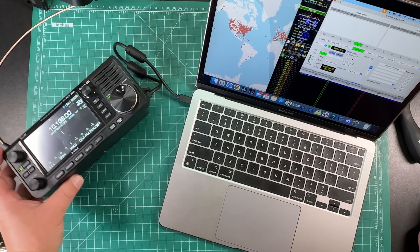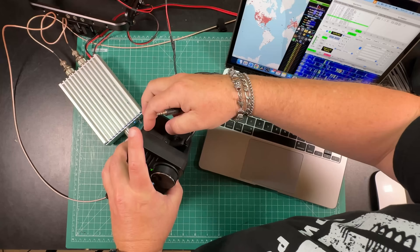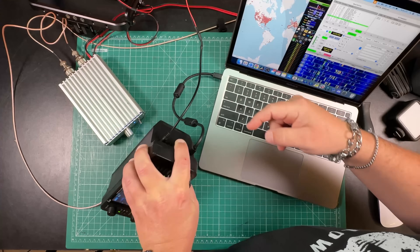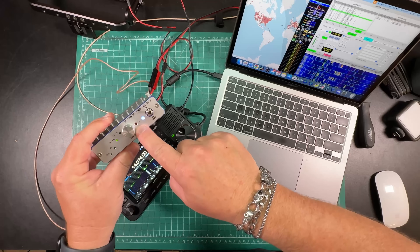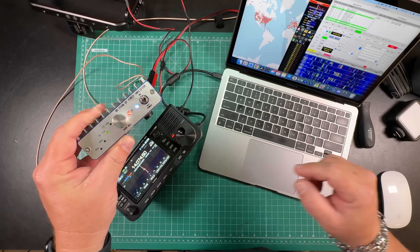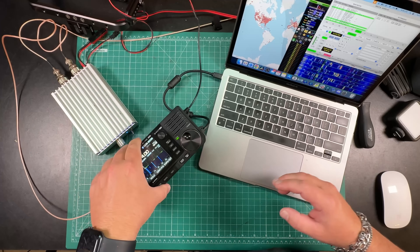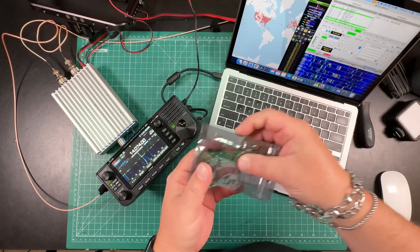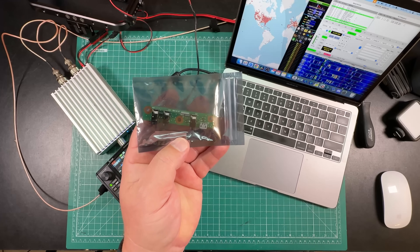And it just works. We can also plug in amplifiers like my MXP50M into the new SEND ALC circuit without fear of frying anything. Watch that red light — I'm going to hit Tune in WSJTX. There we are, it is transmitting. Life is good! I will leave a link to this board in the description, and make sure to put the original board back in your box for the ICOM 705.